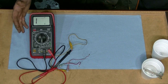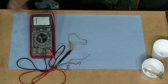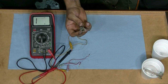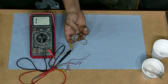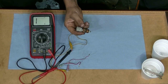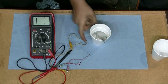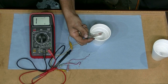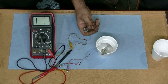What you need to do next is go online or go to your repair manual and find the corresponding resistance reading for different temperatures. This is a sensor from my Ford Mustang, and from what I could gather online, the resistance at boiling temperature — which is 212 Fahrenheit — is supposed to be between 1,760 ohms to 2,380 ohms. We're also going to measure this at a cooler temperature. I have a cup with a small thermometer, and the water in here is about 68 degrees. The ohm reading for that temperature should be about 31,700 ohms to 42,900 ohms.